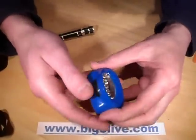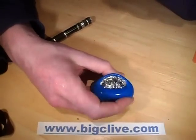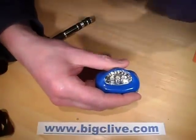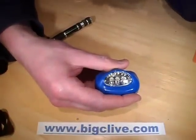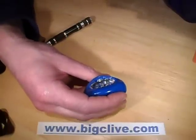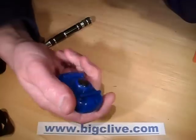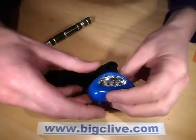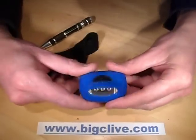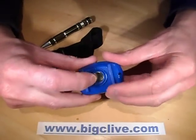You get torches with multiple intensity settings which are quite useful, and you get the ones with super high power LEDs. But if you use three AAAs with a 3-watt LED, the 3-watt LED is going to draw roughly about an amp, and the batteries will not last long at all. So for general purpose use, something like this is very adequate. This isn't actually too bad a wee torch — it feels quite robust. It's certainly no worse; in fact it's a lot better than the original Petzl Tica, which is a criminal thing to say, but there you go.